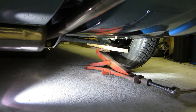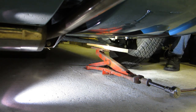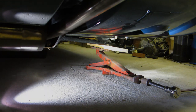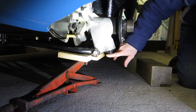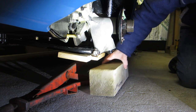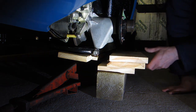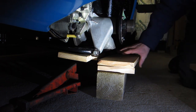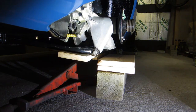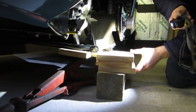Just get the wheel off. Let me show you how I support the hub. You can see the bottom part of the hub here with this metal piece in the bottom of the aluminium — that's what I've supported it off. I'm going to use blocks of wood and just build it up. I'll jack it up a little bit more so it can sit on top of that third piece so I don't have to drop it down too far. I can get a piece of wood in underneath there and then just lower it down onto that.